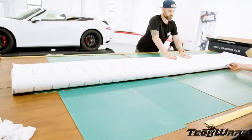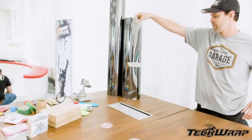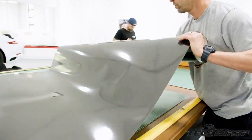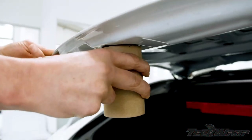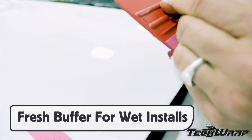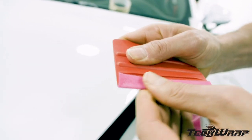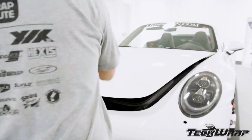For bumpers, fold the panel in half, and this will cover both front and back with one panel. Be sure to clearly label the panels, and working with two people will help keep the chrome from getting wrinkles during this process. For install, prop open sections when possible, and lower surface energy outside the wrap area with masking tape. Be sure to replace the old buffer with the new one to help maintain a pristine mirror chrome finish. With the prep complete, it's now time for install.